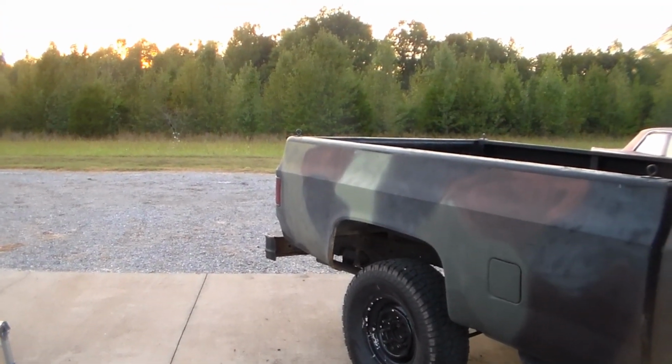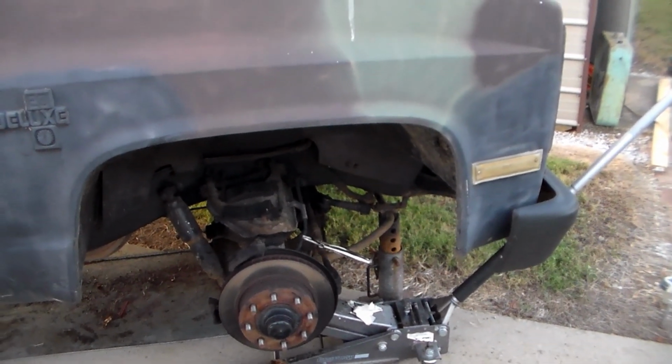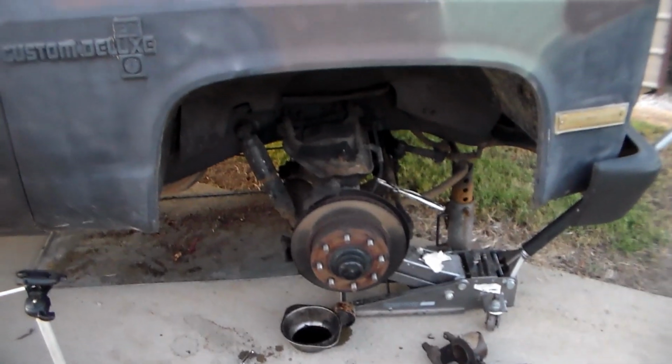It's on gravel. That's no problem, but it's only dragged the left front wheel, so the right front's not working, and that would explain the pull. So I got over there and looked at that other caliper, and it looks a little bit more recent than this one. This one looks original. As a matter of fact, it's on the ground right there.